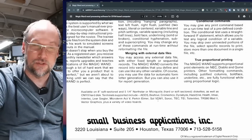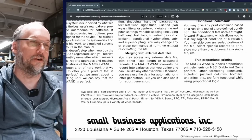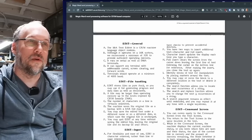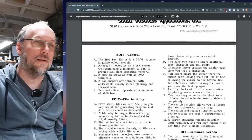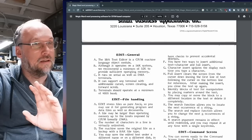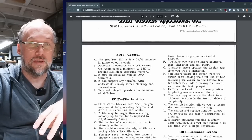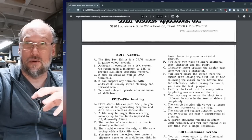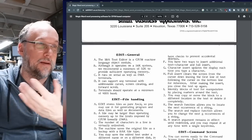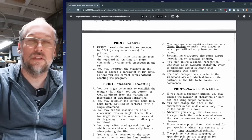Small Business Applications out of Houston, Texas. It needs 16K minimum RAM, 32K recommended. It runs on Serial as well as DMA Terminal — DMA meaning direct memory access, so you had a video board in your S-100 system with memory-mapped video, and the software just wrote characters directly into the video buffer. I'll put a link to this document in the description below.